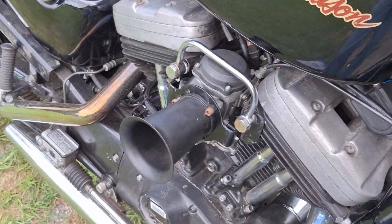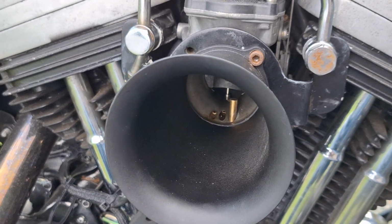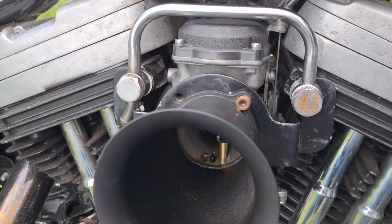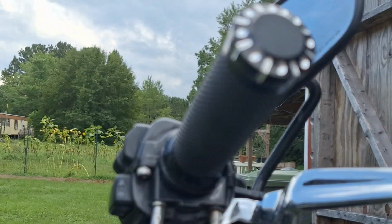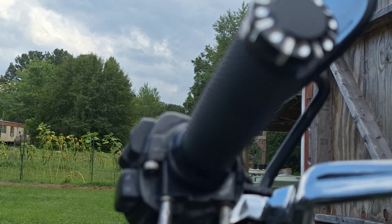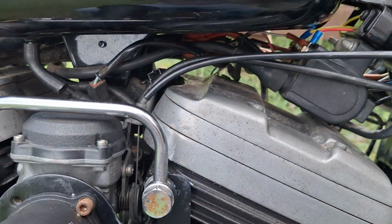So we'll be riding again here shortly if it ever quits raining. But that's it for the grips there. I think they look fairly good. Just go through them, make sure your throttle's returning, make sure you lock everything down on the grips so they're not slip sliding away.